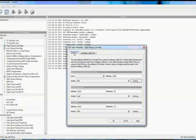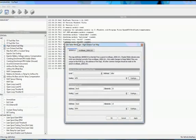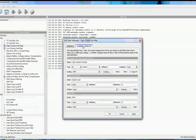If you look at the tab titles at the top here, 88590015 is the XML file that this information is inherited from. And you'll also notice that any given ROM can inherit multiple XML files. So it's also inheriting Evo 9 base from 2008-1101. All you have to know to understand this is that Evo 9 base is a parent inheritance that all Evo 9 ROMs will use. So basically all Evo 9 ROMs will have these same attributes in common. So basically every high octane fuel map for an Evo 9 will be scaled to an AFR with an x-axis of load and a y-axis of RPM.